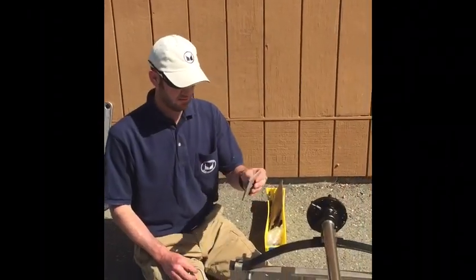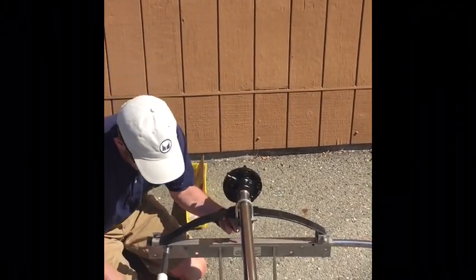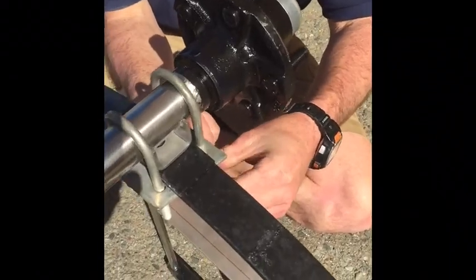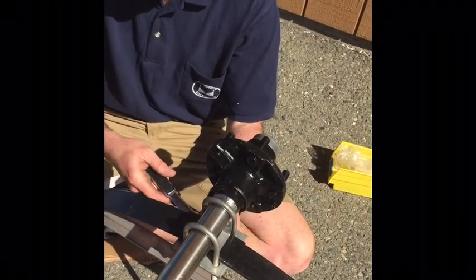With the U-bolts on, this backing plate slides underneath here like that, and the U-bolts simply slide over with a lock washer and a nut just to get it started. And tightening the nuts on the backing plate right now, and then we'll tighten it with a socket afterwards. Just finish it, tighten it with a socket. Don't over tighten it because you'll bend the plate a lot.